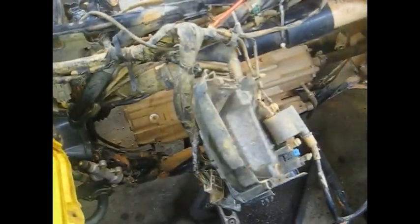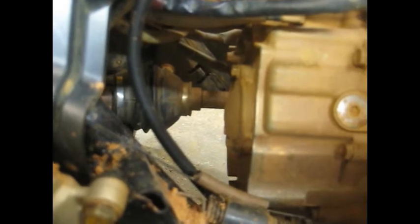Next thing we need to do is put this thing at top dead center. I may end up having to do a bottom end on it but hopefully I won't. To get that, we have to remove this plug here - the allen head, I think it's a five millimeter - then these three bolts back here where the pull start would normally go, three 10 millimeter bolts. An air ratchet and a 10 millimeter gets those off pretty quick. Got the pull start cover off. That allen head bolt was actually a six millimeter - I mentioned five earlier but it's six.